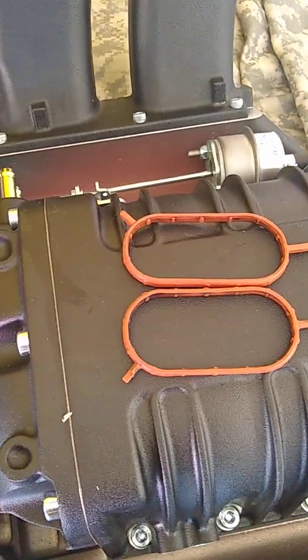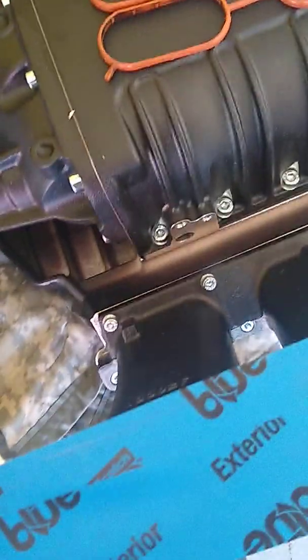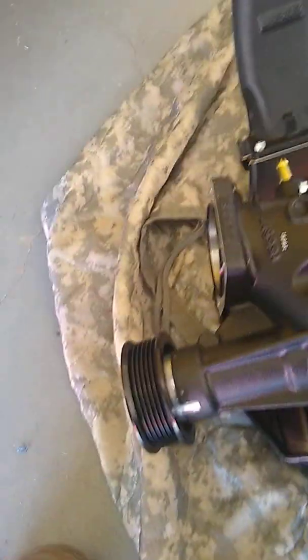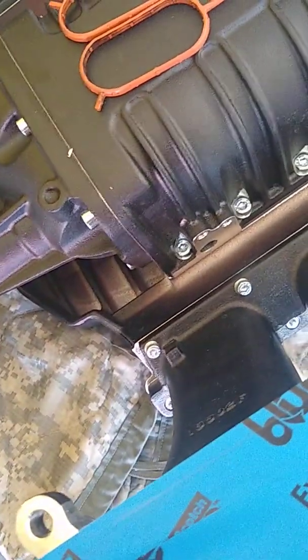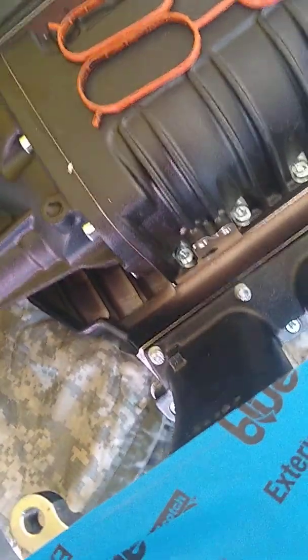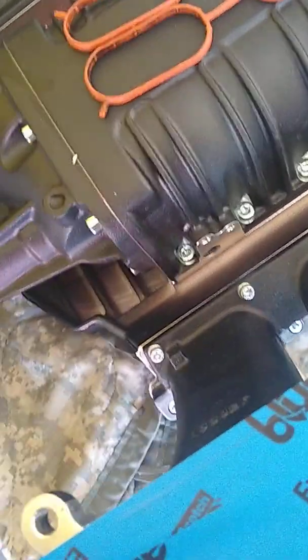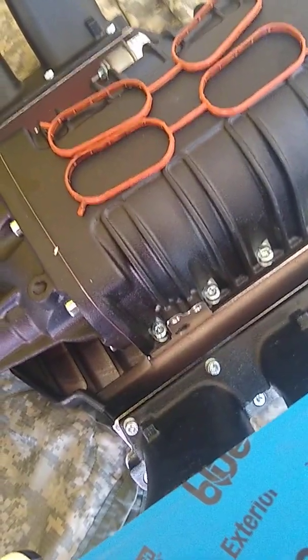These are my two gaskets. They were not crushed, cracked, nothing. They were perfectly fine. I will say that the holes on the base of the runners don't stand very far above those holes. So I'm wondering if maybe part of the issue could be that they need to be just a hair longer, or the holes on the runners were just a little too deep. But like on the pictures that I posted, you can't see any blow-by coming around the seals themselves. You can see plenty of dirt on the outside, which someone pointed out is probably because I sprayed about 3 cans of carb cleaner around checking for leaks. It probably just cooked on there.